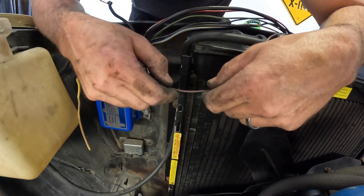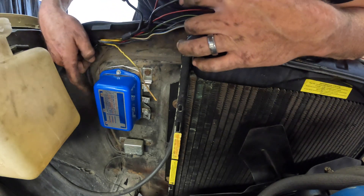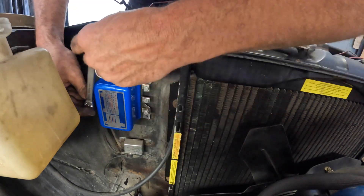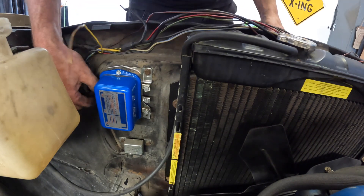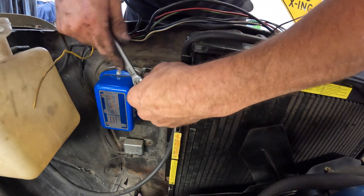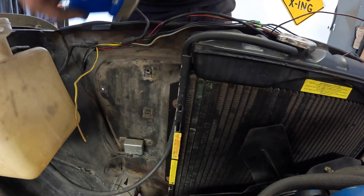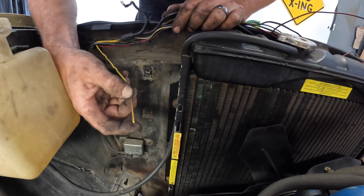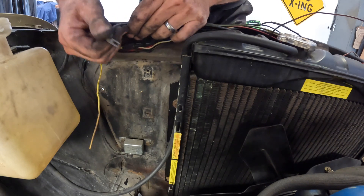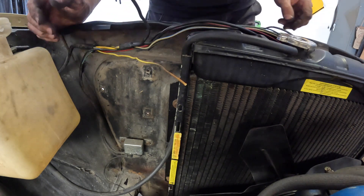The third wire that attached to the generator is this red with black, and it just goes to the ground on the radiator support — the voltage regulator ground — so we'll pull it off and pull that wire out of the harness. That eliminates the ground wire. Now we have no wires left on the voltage regulator, so we can remove it. The two remaining loose wires are from the idiot light and the battery voltage for the regulator — we'll cut those, tape them, close the loom back up, and then get working on mounting the new alternator.